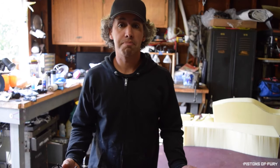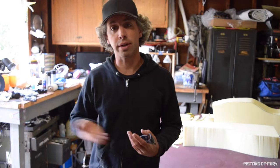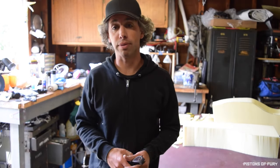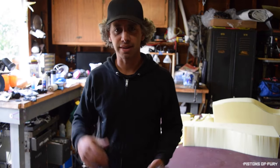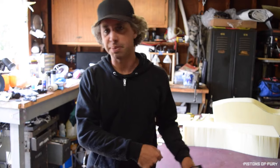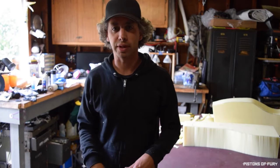Alright, so I think that works. Basic takeaway, like I said outside, is if you're using a high-powered sander like that, just remember the foam's really delicate. So just watch the edges of the sander, because you can cut right into the foam and slice a big chunk off really, really easily. So it's a really heavy tool to have to use in that kind of delicate way. Usually you just plop it on a big piece of metal and sand away. So foam, definitely a little bit more of a delicate operation, but it works.